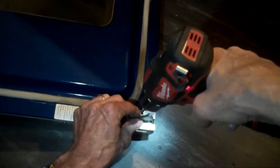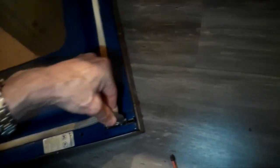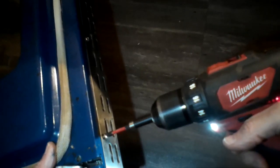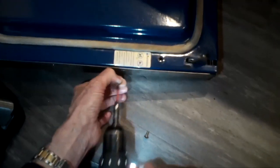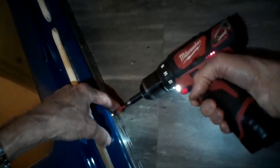The reason you know you have to change it is the oven door doesn't close quite all the way. So as it heats up, a lot of heat is escaping up near where the controls are for the stovetop burners. So now we're just removing some of these perimeter screws — in this model I think there were about 30 of them, just small Phillips head screws. These springs just get tired over time and they can't close the door far enough to really seal in all the heat. The problem with that is it's hard for the oven to keep temperature, and also some of that heat can damage the controls that live up near where the burner controls are.